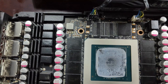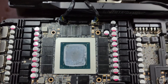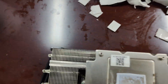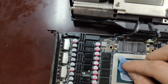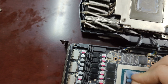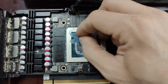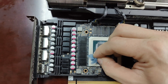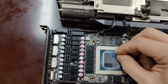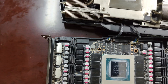How we do that is we spray some rubbing alcohol and tear off a piece of shop towel, and then we use it to remove the old thermal paste. We just need to get enough off the chip itself. We don't need to get the corners because the thermal paste is non-conductive, so it doesn't matter if it's on the little tiny chips next to the core. What matters is that we get it off the core to have nice, even heat removal.